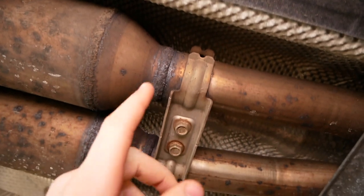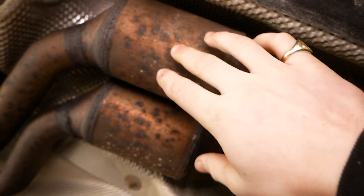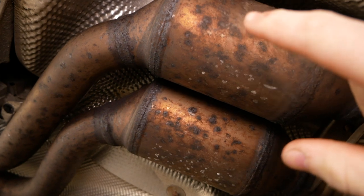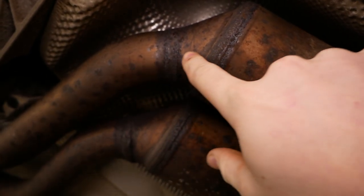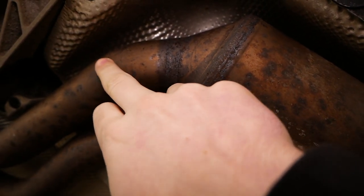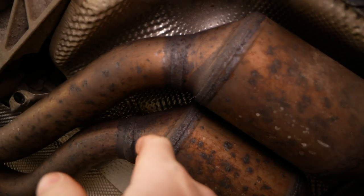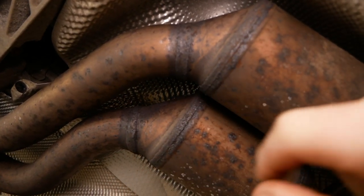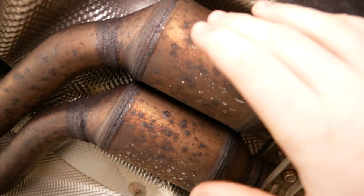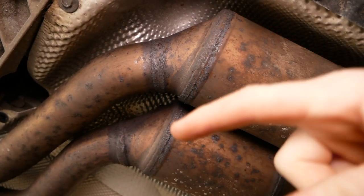Same thing right on the back here — just chop it there, remove them, remove the material inside, and then we'll weld them back into place. Now very important to note: you want to draw a line across the area that you'll be cutting, and that's going to allow you to line it up perfectly. I'll basically draw a line from here to here, make my cut right in the middle of that line, and then line it back up when we're re-welding it. Of course it is necessary to fully remove the exhaust system from the car so that we can weld all the way around the pipe.